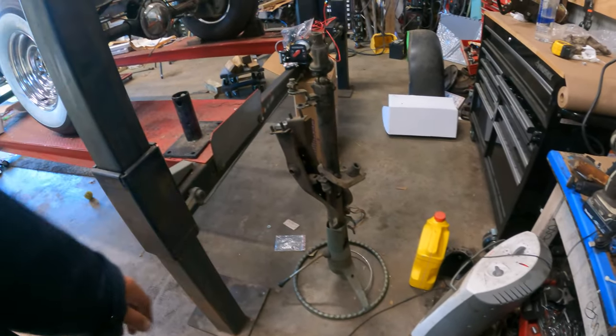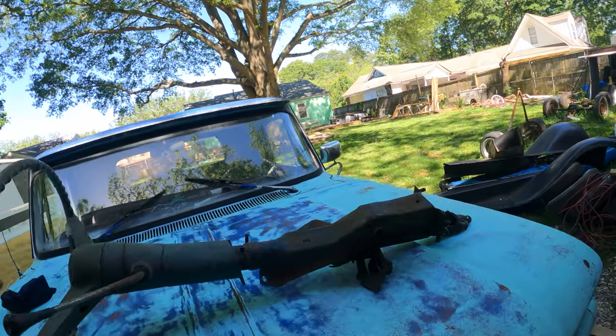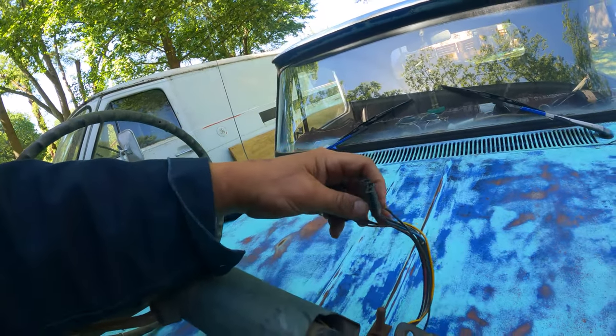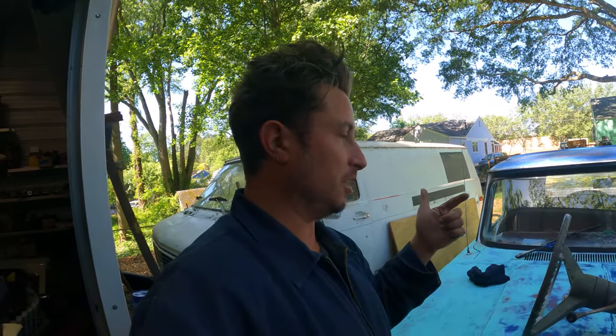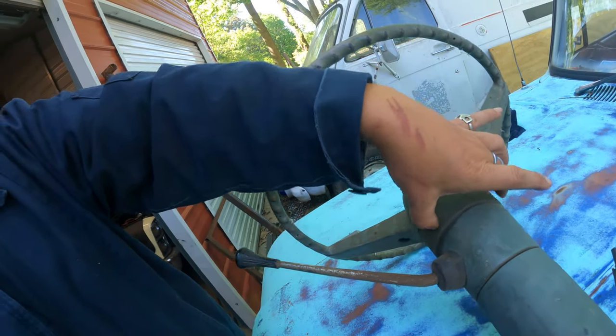So, steering column. Well, I bought this. Let's talk about it. This is a 63 Impala steering column. Obviously, it was a 3-speed on the column. And it is in the early generations of standard GM wiring. I jumped on it because I wanted something cool to run in this car, and I wasn't really particular, but early Ford stuff's really expensive if it's going to be decent. And this had the added benefit of being cheap, local, and the turn signal knob is missing right here, but this has turn signals in the housing.